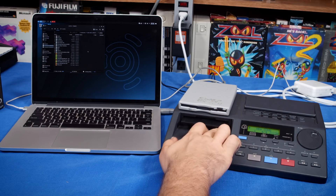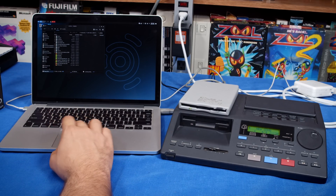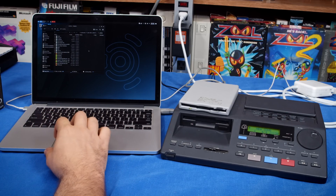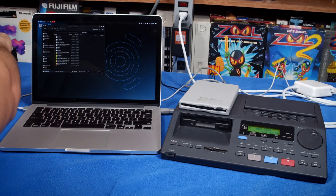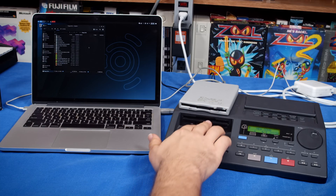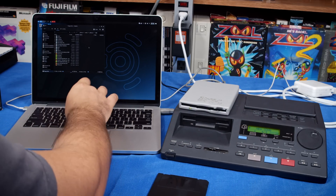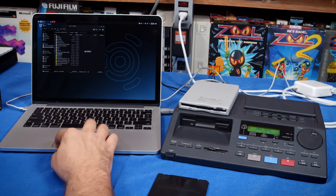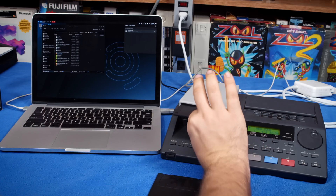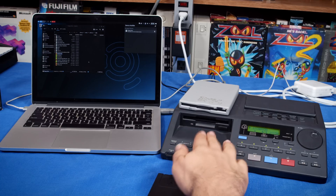The disc is formatted, and I wanted to show you just how simply easy it is to make a disc with MIDIs on here. I'm going to go ahead and open this disc on my Mac here that's running Linux. It's loaded - and again, this is what's super weird. If I take one of these - that disc just worked. If I put a disc fresh out of the box of Maxell discs: improper disc. I'll put this into the floppy drive here and refresh it - it will also work with no issues. I'll copy a MIDI onto this one. It won't work - or it will and make a liar out of me. This is why it's taken me so long to make this video. This thing is extremely unpredictable.